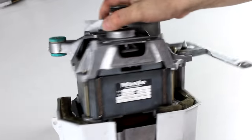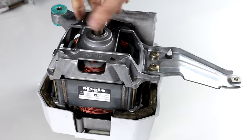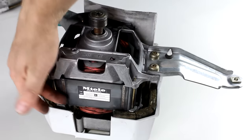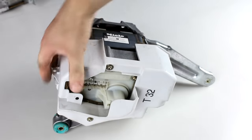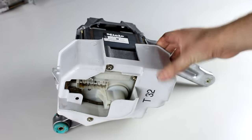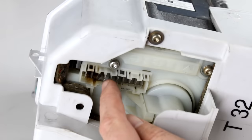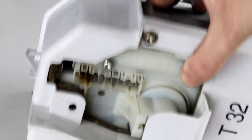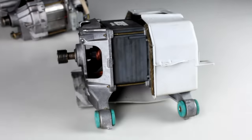So let's take a closer look at this motor and then take it apart. We have a pretty small pulley for a ribbed belt sitting on the pretty massive motor shaft, and then we have this bulky rectangular stator pack made from transformer lamination that was also welded together. On the back side of the motor we have a plastic cover and we find a 10-pin connector. One of the main reasons for this video is to show you how to find out the pinout of the connector on your motor, because without that a motor like this is pretty much useless to you.